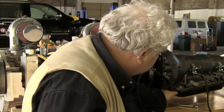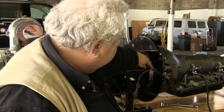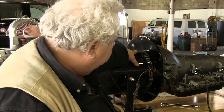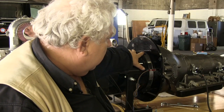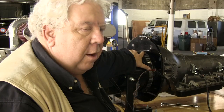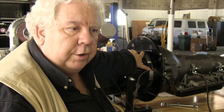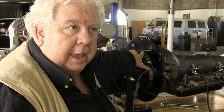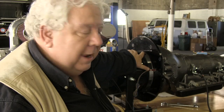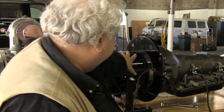So as our flex plate rotates, the way Brian's got this mounted in a hole, as close to the motor as he could get, it causes this to output a pulse, and we need that pulse as a tachometer input to our Soliton 1 controllers. And we'll talk a little bit about why that is in a minute, because it's got some neat features.